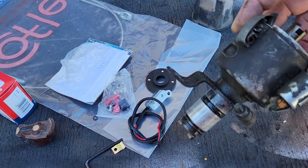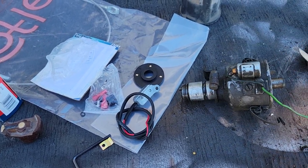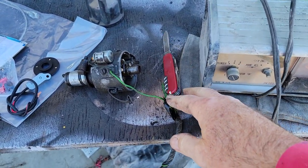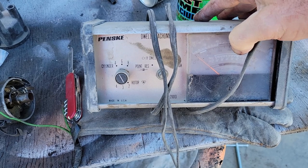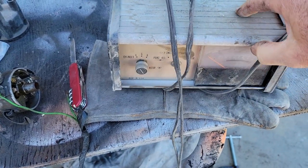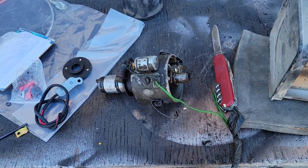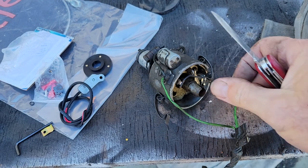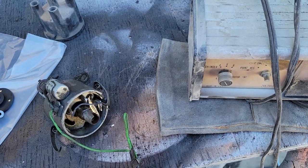The reason I don't take this bracket off is that when I put the distributor back in, the timing is going to be very, very close. I set my point gap if I'm using points, put it in, and check it with a dwell meter. The reason you use the dwell meter versus just using the gap all the time is you get a more accurate reading. I set my dwell at 45. The reason you use dwell meters is if you're using an older set of points, you just throw it on there real quick and make sure your points aren't closing. Really good idea to have a dwell meter if you have points.